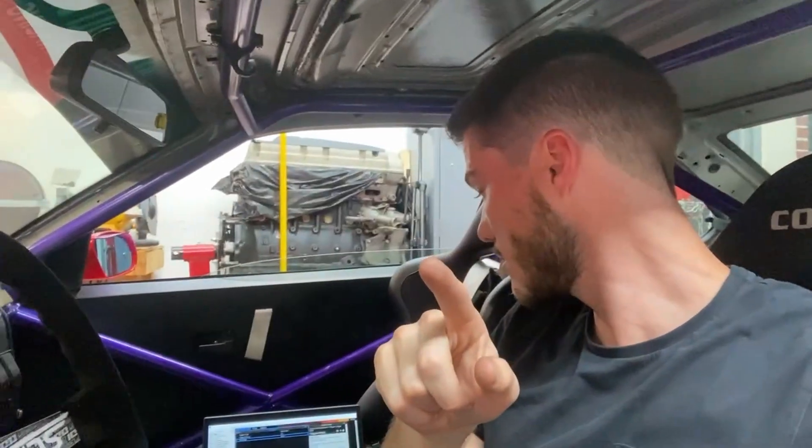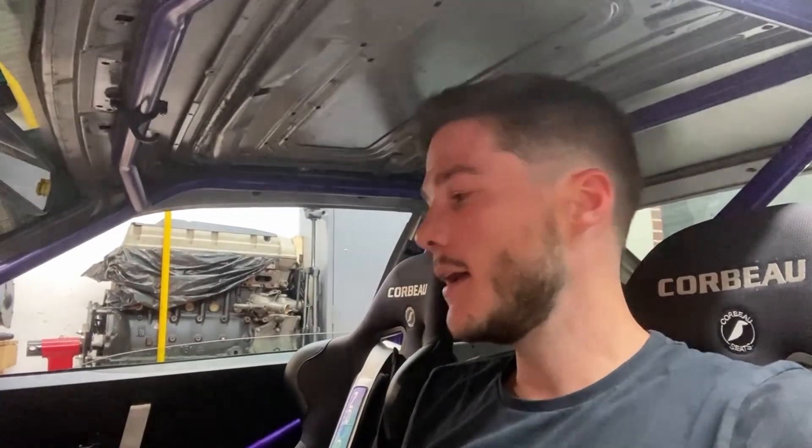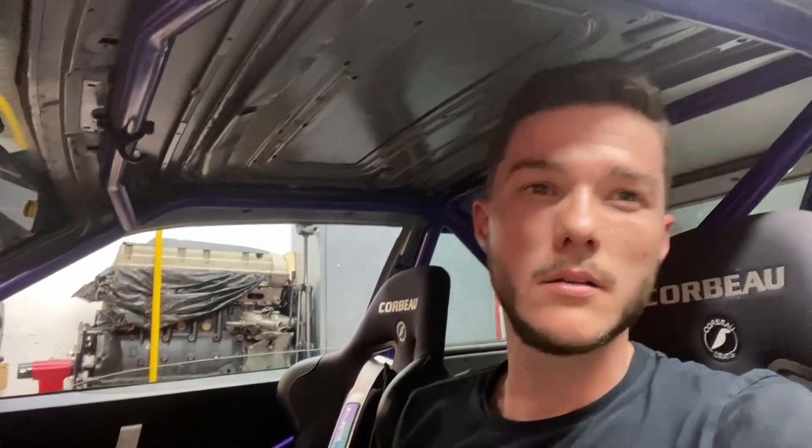Just took it up and down the road for a while. I'm realizing something. With this new cam sensor, if we cut the car on and then we see trigger signal two active and we slap start, it will hold it the whole time I'm going up and down the road — fine. If I let it disappear and then press start, I don't get it, and I don't get it the whole time.